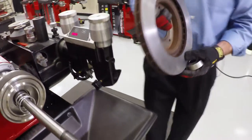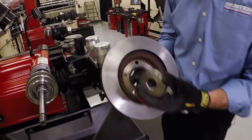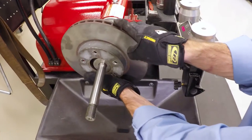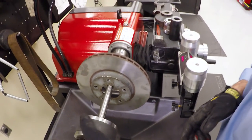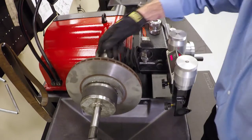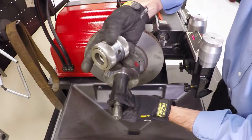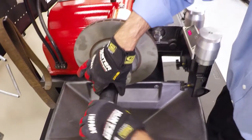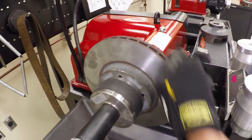Going back to the rotor, I'm going to find a cone that fits inside that — this one does well. I'll mount that on the lathe, then turn my workpiece and mount that on as well. Grab the outer cup and slide it on, grab a spacer, and make sure the rotor is now on the cone. Take the wing nut, threading it to the left to tighten it. Again, I didn't use the tool to tighten this, and I've got my workpiece moved as far to the right as possible.